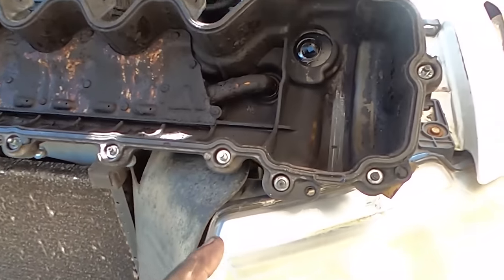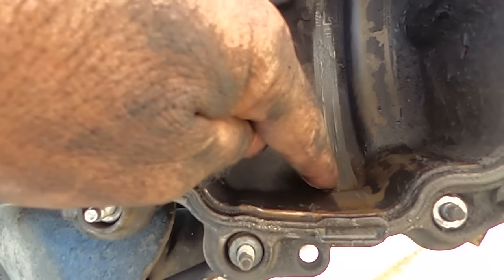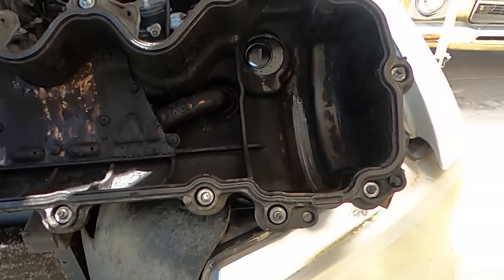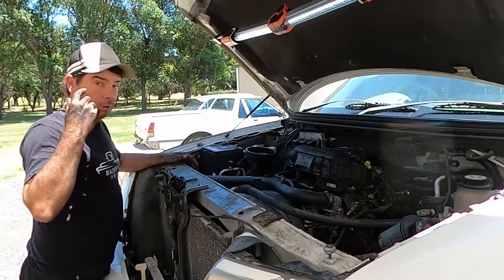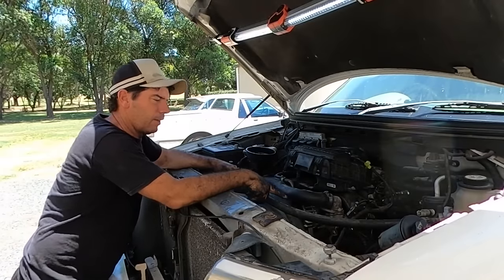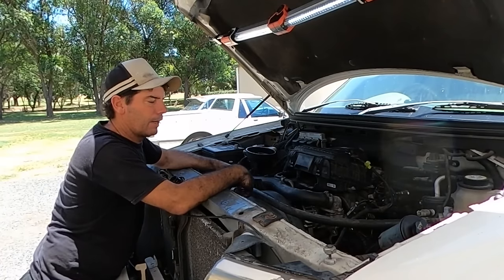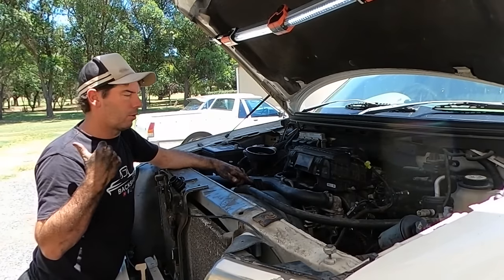That's the underside of the rocker cover. Well, that's a score mark where I'd say the top of that chain there has actually hit it. So I'm not going to lose my mind over that just yet. Well, I am, but I'm going to tell you that I'm not, because that chain doesn't look new, but it's 480,000 kilometers. It could have had chains at 300,000, that's got 180. Is that historical damage is what I'm getting to? Has that been there for a hell of a long time?